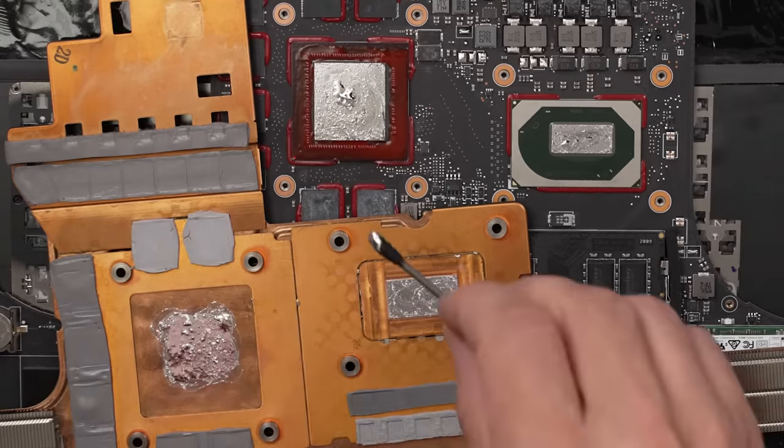Okay, now hopefully I can get this display back installed. Okay, good so far. Display cable. I don't know why I disconnected that without disconnecting the battery first. Always disconnect the battery before you work on any display stuff, because simply messing around with this cable with the battery hooked up can cause it to burn out the backlight and probably other things too. Hopefully I didn't do that here. We'll find out soon enough.